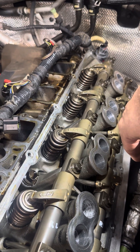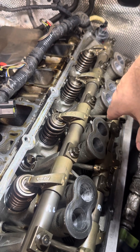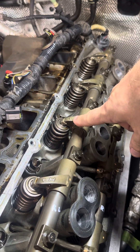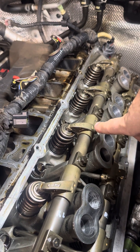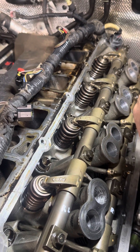If you suspect that after you've diagnosed a misfire, obviously check your fuel, check your spark, check your compression. If you've still got a misfire, your next step is this. It's a common fault with the Hemi V8s — this is a 5.7. The camshaft lobes wear out and the pushrod can't lift high enough to open that valve.